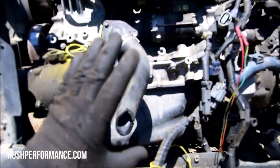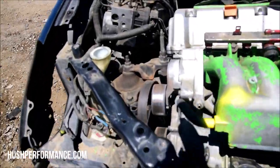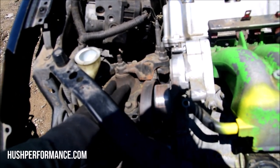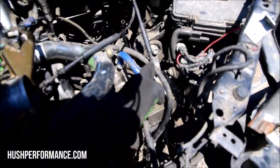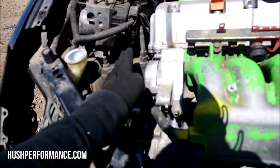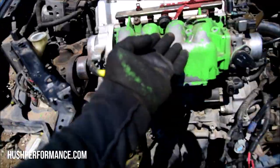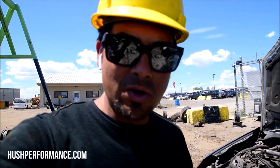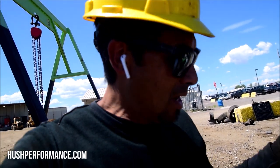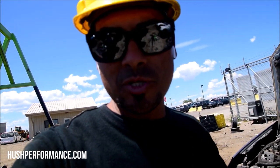The AC compressor is up against the frame rail. When I loosen these, it's going to do something weird and might cock the engine back in a weird way. You want to keep caution on this kind of engine - these motor mounts have a pillow mount. When I pull the transmission out on this side, the only thing left holding the engine in is the other side, and a lot of times the pillow mounts are broken. Once you drop the transmission, if it's broken, the whole engine would fall. I need to get underneath while both motor mounts are still holding the engine in, take off the inspection plates, and then work myself around to the top.